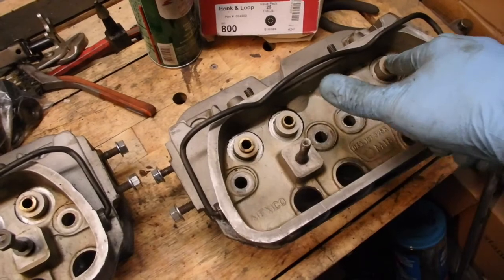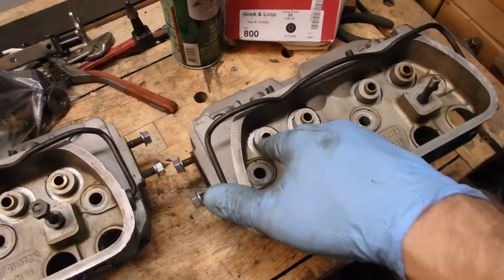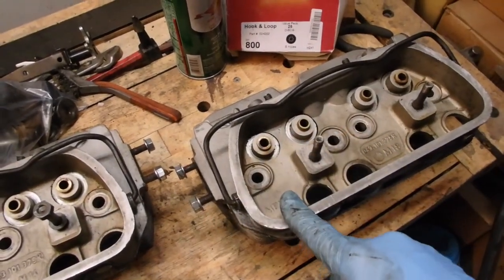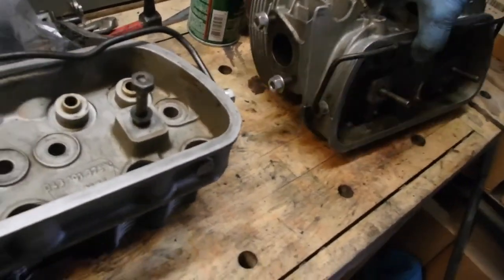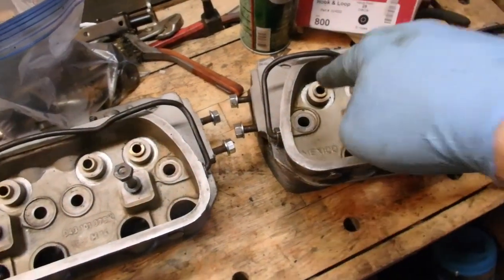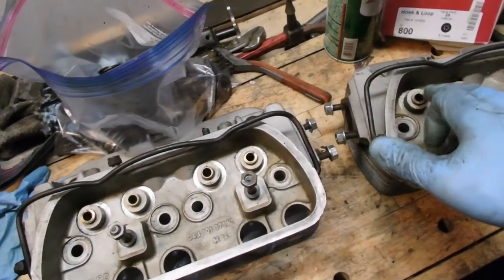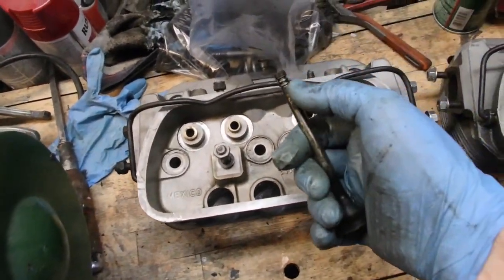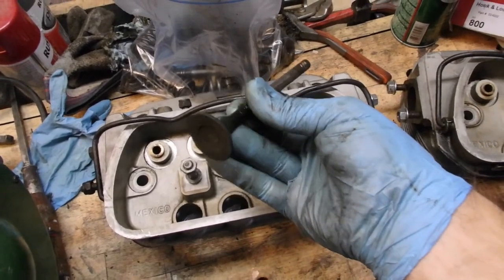I believe these have oil in here, and we do not have valve stem seals. So if there's a little bit of oil moving past the valves, I don't think that's terribly concerning. Because the way this thing is canted, the valves going that way are not going to have oil go from down in here, up the valve stem, and into the combustion chamber. So again, I'm going to make sure it's a pretty good fit — I'm not taking metal off, I'm taking crud. I'm going to take off a little bit of that carbon buildup, but other than that, I think we'll be all right.